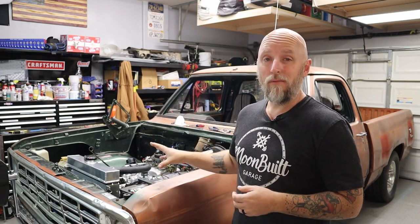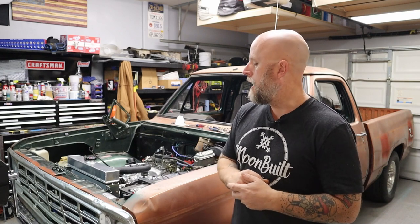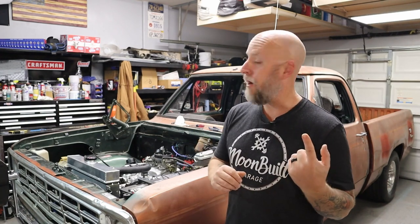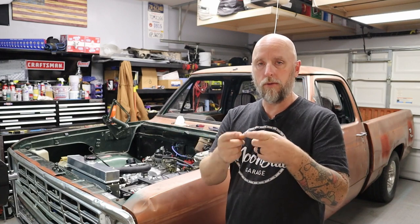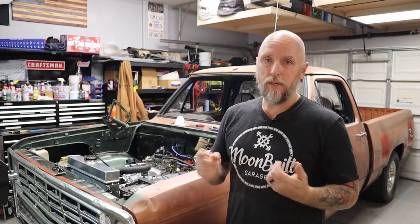So this thing is just about ready to get out on the road and give it a shot. I do have a few issues I still want to work through. I'm going to investigate the header - I think I have an exhaust leak in the driver's side header. I hear that tick, really annoying. I also think I have some vacuum leaks - the carburetor surges. I already found one: on the back of the carburetor, the line that goes to the PCV valve, there was a little T fitting that was loose. As I was tightening it down, the nipple broke off. So I've got to get a new fitting - it may have already been cracked. Once I get a new fitting on there, I'm going to start doing some checks for vacuum leaks.